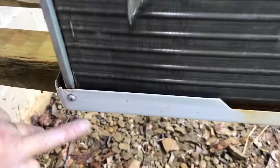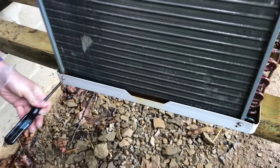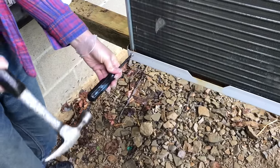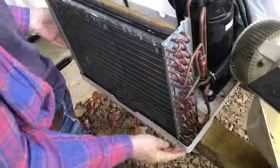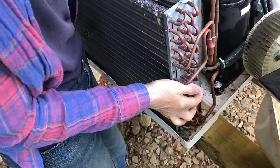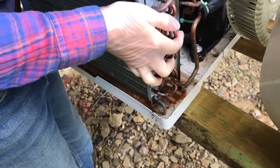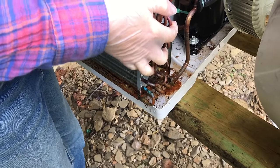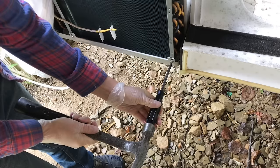To remove these coils, we need to remove the two screws on the bottom — they might be pretty corroded, so you might need to tap the back of your screwdriver with a hammer. Now we can lift this up very carefully and set it on the edge, doing it very gently because we don't want to bend any of the copper pipes. This gives us access to wipe underneath, and there can be quite a bit of debris underneath the coils. We'll do the same thing to the other side.